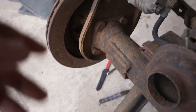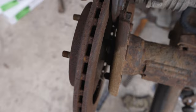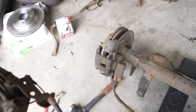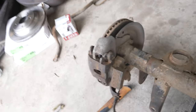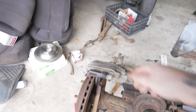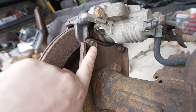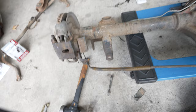As you can see, there are four bolts that hold in the axle and all this stuff together — that's the receiving end on the axle-end side. You take out the four bolts on the front and all this slides off. The same four bolts are on the end of that axle tube right there. So you just slip all that off, throw these on, then put these on. You might have to get these two bolts right here that hold them on underneath, but other than that you should be good to go if you wanted to upgrade.